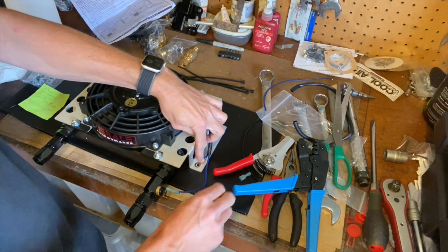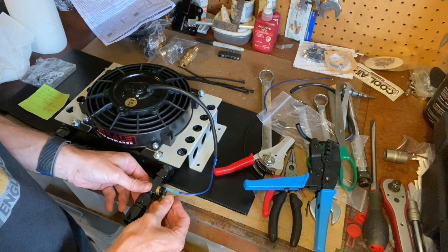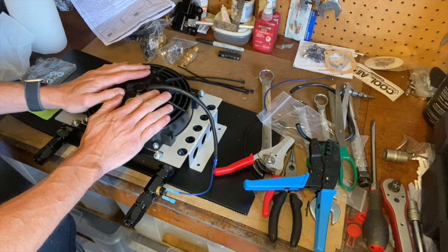That's as far as I can go today on the oil lines - I can't do any more until I've got the engine in the vehicle so I can mount all these components in the engine bay, then cut the hoses to length. I bought a fancy hose cutting tool - a pair of proper hose cutting shears - because I'm always cutting oil hose and fuel hose with a blade which makes quite a rough cut. These shears just put the hose in and snick cut them, which is very handy for the braided stainless hose.